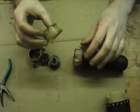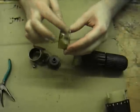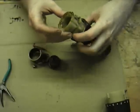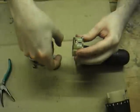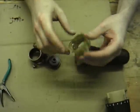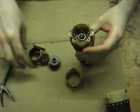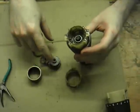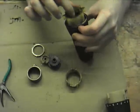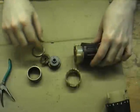Generally, motor in the same arrangement, back end of here. The two-speed ones tend to only have screws connecting the front half and the back half of the gearboxes. So, rather than trying to cut anything open, you actually find that you have to twist the motor's mounting plate off. It's got a little bayonet cap arrangement there. Now, front end's much the same. We actually got a little slot there the spindle goes into. It allows a little more motion, I suppose, but again, not important. That may be permanently attached, it may be part of it, it may be a separate element.